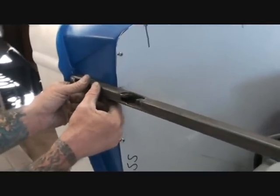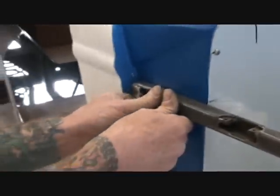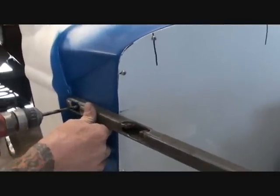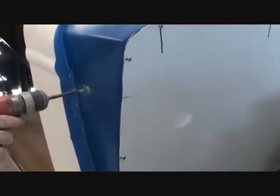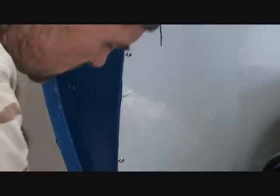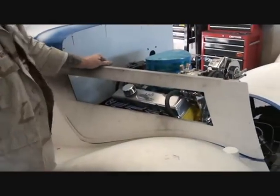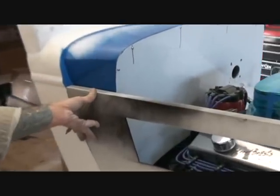I'm going to line that up with the outside of my firewall. Then I'm going to come over here and line the arrow up with the top of this bar. As I'm holding that in place, I'm going to double check. The hole that we drilled I'm going to use for a pilot hole, and I'm going to start my hole — now I'm going to drill my hole out. I'm going to take my bolts; this is just for temporary use, we will be taking these off. Okay, we've got our bar installed and everything's lining up — our line's lining up good.